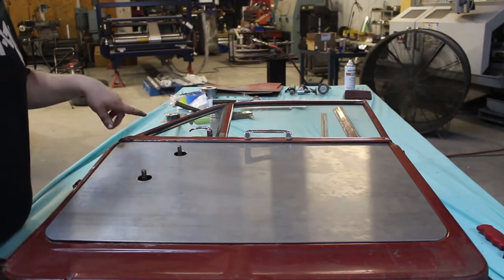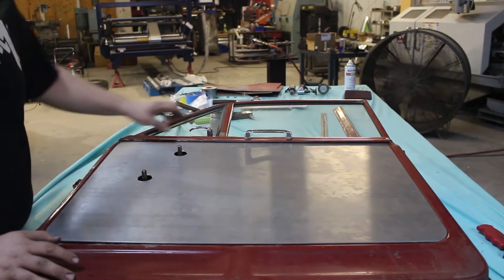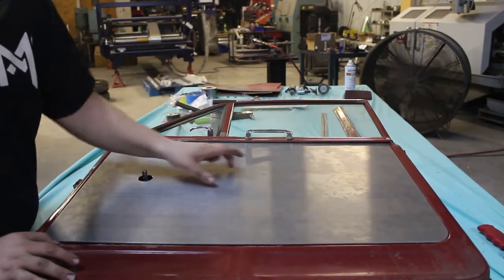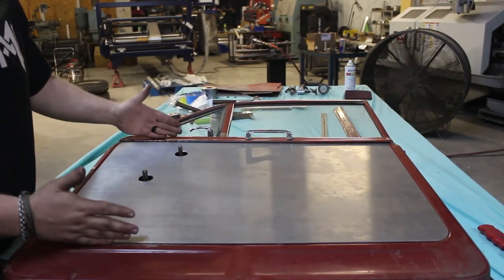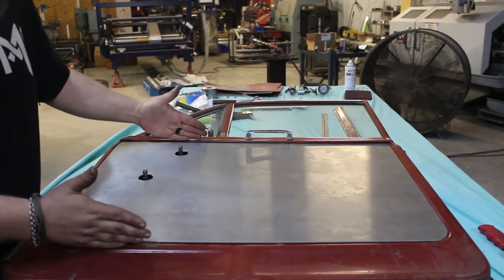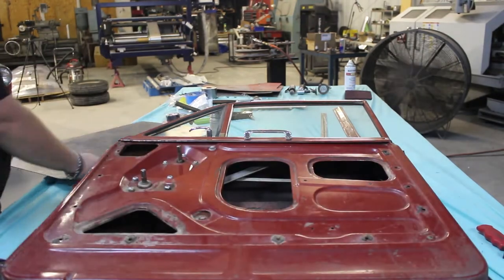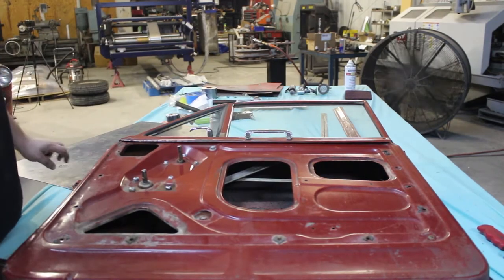Here are the door panels we're making for this door. On this door it has a top garnish piece that overhangs the top and has the pull handle for the door. There is originally an armrest here but we're not going to be putting it on. This was a square piece that we measured out from the indention on the door right here, so we had this sheared to that measurement. Then we went ahead and found the radius of what the door skin had in this area and marked it on the edge of the door panel.